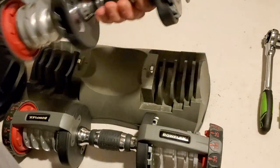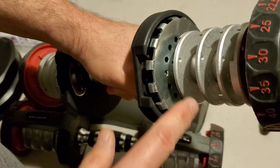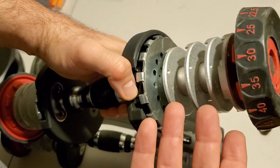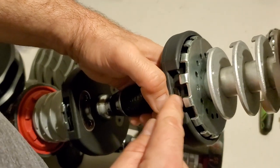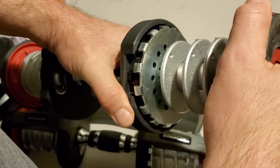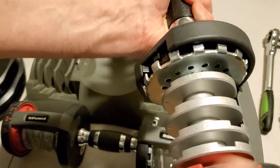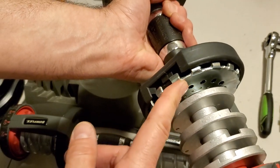On this improperly assembled one, I don't even have to touch this button — it just moves freely. Totally wrong. This is not assembled correctly. It might be tight enough where every once in a while this works, but it still mostly doesn't. This one's so bad without the washer that it just moves completely freely, so the ball bearings aren't doing their job at all anymore.